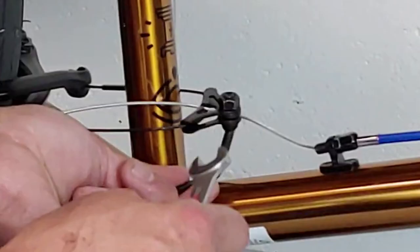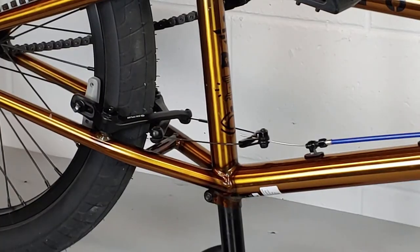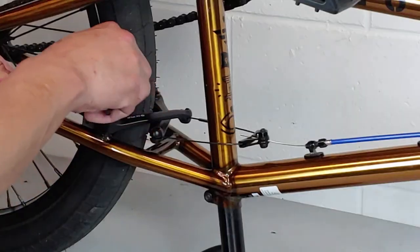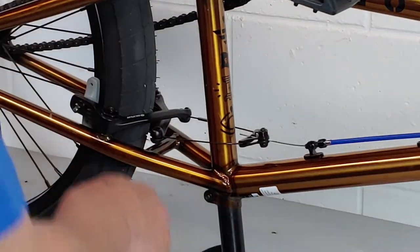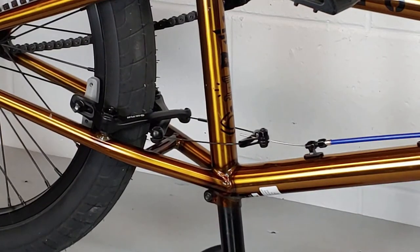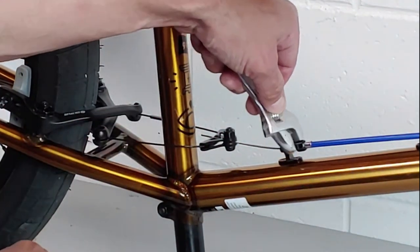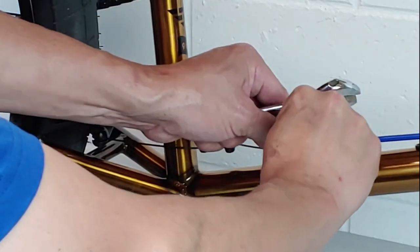After you get this tightened down, adjust your barrel adjuster to where you like how much pull your lever has, and then clip the excess cable. For the adjustment, pull the lever a couple times and watch which arm moves more than the other. The arm that moves less — put a little more tension on that side of the spring by loosening the top bolt, twisting a little more tension into the spring with the wrench, then using the Allen wrench to tighten it back down, until each brake pad pulls away from the rim the same amount. After that, tighten down the jam nuts on your barrel adjusters.